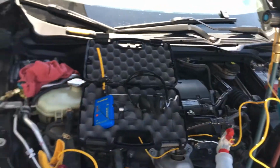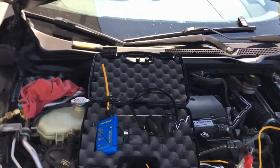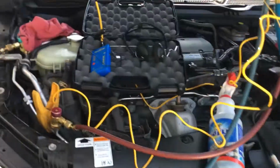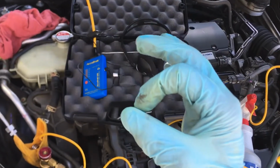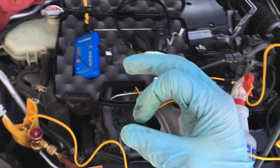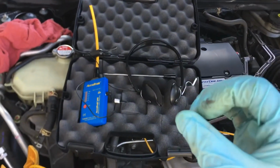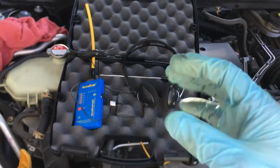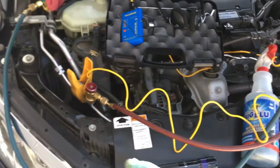because once you have hot refrigerant flowing through a liquid line, you expand the metal and you can cause some leaks. With these TYC condensers, the comebacks that have come to the shops, where they had to do them again, were because the fitting was machined a little bit bigger, and when they would get hot and under high pressure they would expand. All you've got to do is expand 1/1000th more, and if that O-ring was just barely sealing before and you open up a little bit with some hot pressure, you bypass gas and then it'll leak. So I tried to go through all the scenarios.